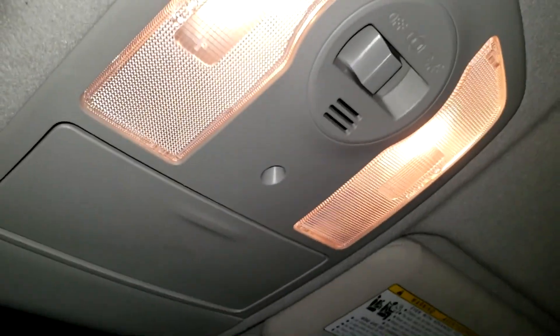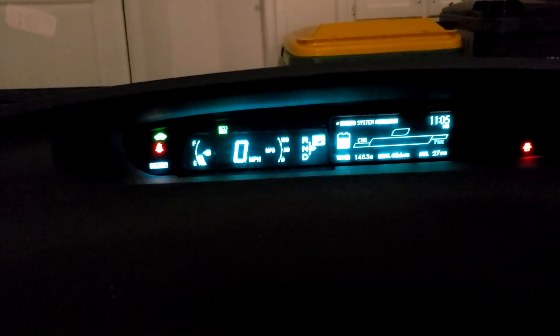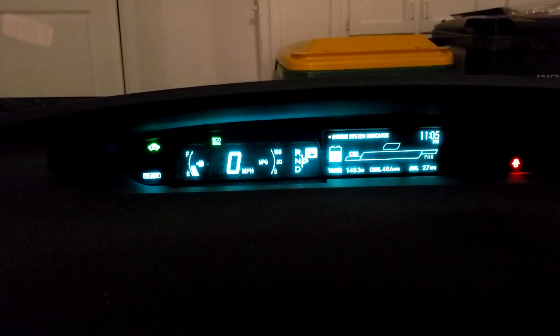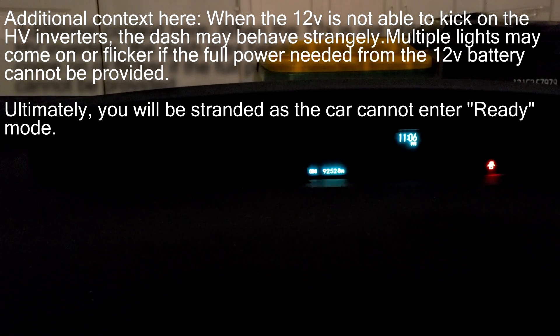Inside the car, I'll start it to show a warning sign. The lights are on — when the car starts or the brake booster kicks on, those lights get a little dimmer. That's not necessarily a sign on its own. The big sign is when you try to start the car: the dash lights go slightly dim and then kick on. I've noticed this takes a little bit longer than in the past now that temperatures are closer to 60 during the day and in the 30s in the morning. When you do have battery trouble, the dash will flicker, which can lead to lots of assumptions that other things are wrong with your car.